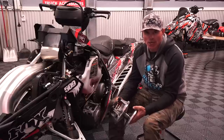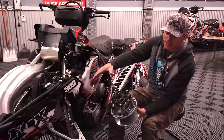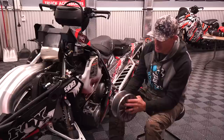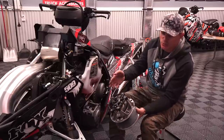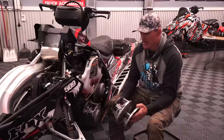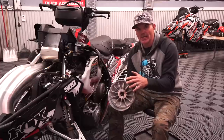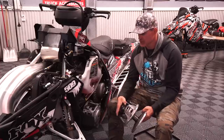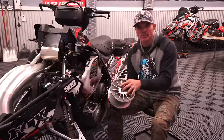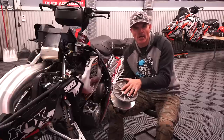Pre-season, if it's a turbo sled, I would change the spring. The other thing to inspect would be your weights. Once the spring is released, you'll have no tension on your weights, and you can make sure that everything is flowing freely. Cleaning these things with some brake cleaner and making sure that everything goes together. You can have all the power in the world in your engine, but if you don't have the clutches working properly, we're not getting any of that power to the ground.